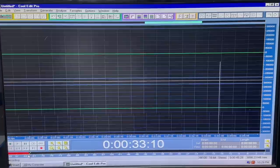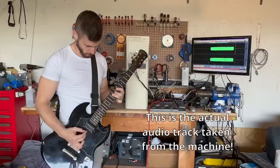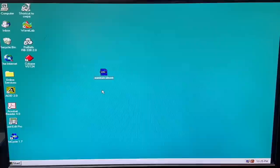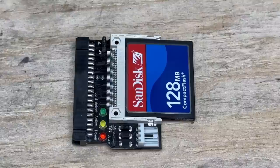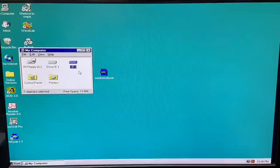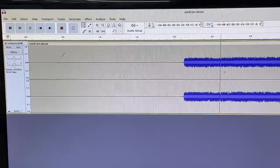I got to try something — I apologize in advance for this. That's quite enough of that. Now I've got to get this WAV file off of here — it's too big to fit on a disc. For that I'm going to use my CF card to IDE adapter, plug that straight into the motherboard and give it some power. Look at that — there's like no noise whatsoever. That is amazing. There is nothing old or obsolete about that sound card — that thing's amazing.